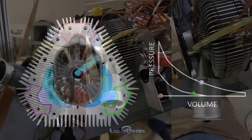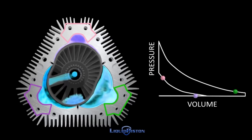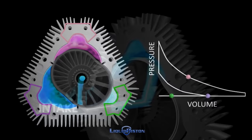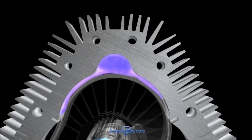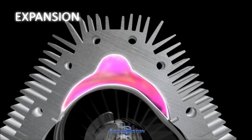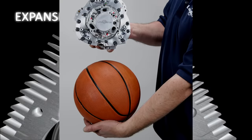There are only two moving parts with no poppet valves, thus reducing noise. The combustion chamber is stationary with direct fuel injection, so it has a higher compression ratio of 18 to 1, which is almost double that of previous Wankels. Another notable feature is that the apex seals are stationary — they're not bouncing around inside the rotor, and they're directly lubricated from the housing.